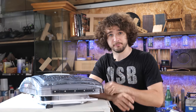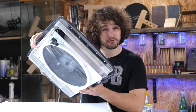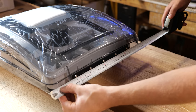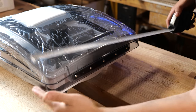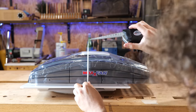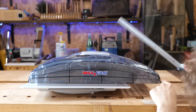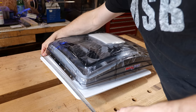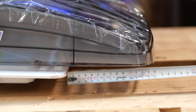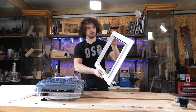There are chapters below so you can skip to relevant sections. First impressions: it's extremely light, really well packaged, and actually a lot smaller than I thought. Just in case you're trying to squeeze one into your roof, the overall dimensions are about 600mm long and 400mm wide, but it bulges a little so leave about 430mm minimum. Measuring from the roof flange, it'll be about 120mm tall in the middle, 60mm at the front, 45mm out the back, and the roof flange itself is 465 by 465mm with the back overhanging about 140 to 150mm.